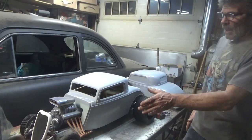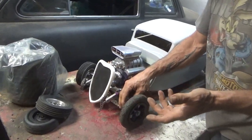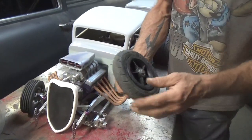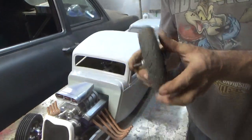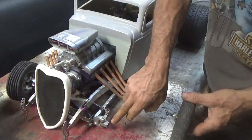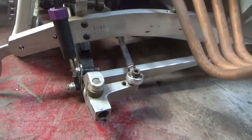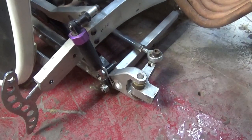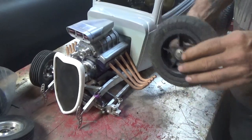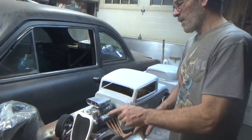The fronts are a little bit skinny and I guess some manipulation is needed — because basically a 5/16 bolt fits through these wheels. These wheels are for an electric scooter, found them on Amazon. This is like a 9/16 fine thread that goes in there, so I've got some manipulation to do — gotta do something funky to get something to thread in there for roughly a 9/16 bolt. I'll figure something out.